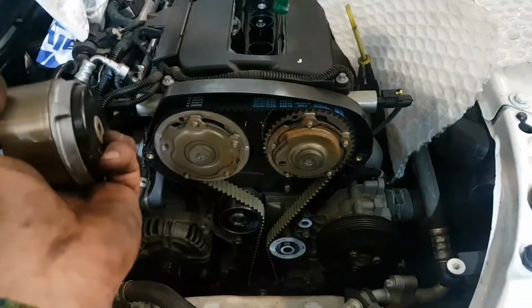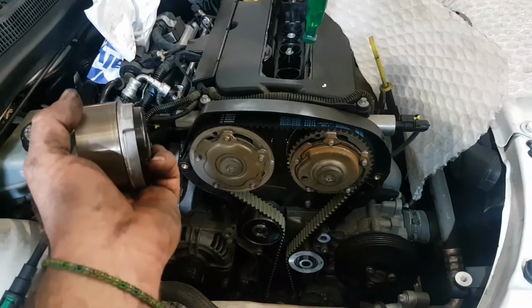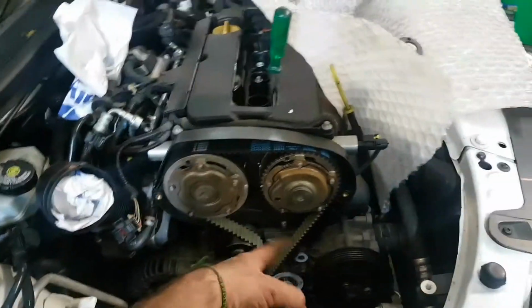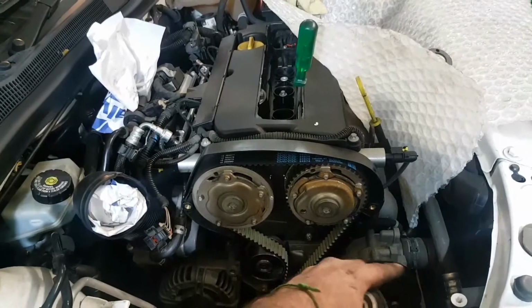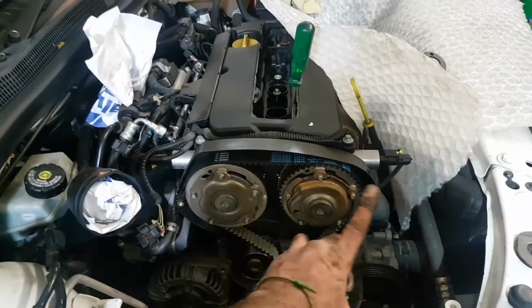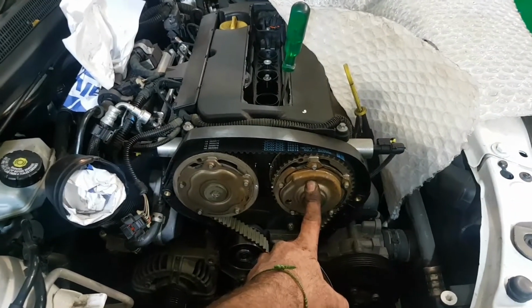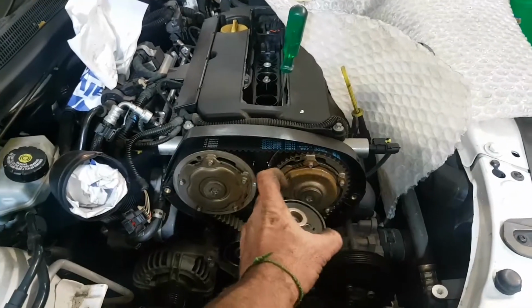It's a nice revision to the XE, and a significantly different engine actually, with many revisions. But of course, once you do this, you turn the engine, make sure it all lines up. But I was just trying to help where, if you think they're both stubborn and moving, they're not. This one, once you jiggle it and get the oil out of the lifters, it stays. And even if it doesn't, you can sort of move it a bit.